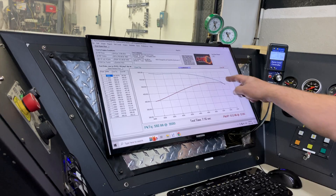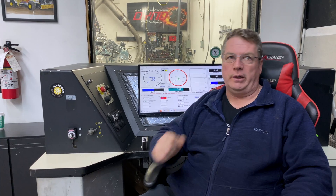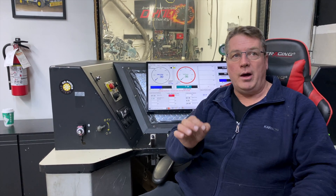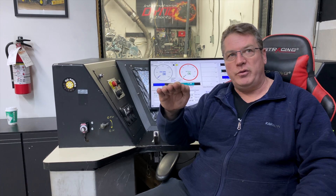We came up against a rev limiter at 5,000 RPM. With each one of these tuning passes we're collecting data and making changes based on that data. We're changing the fueling — in the carburetor, we're going to put in either smaller or larger orifices called jets. We'll make a small change, collect the data again and see if the change worked. After that we're going to change the timing to make it start better, do the low-speed jetting, and monitor the air-fuel ratio all the way through to check where we want to go next.